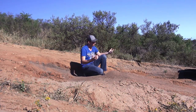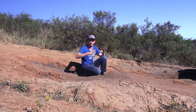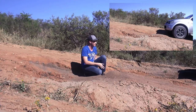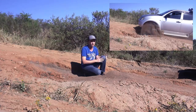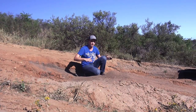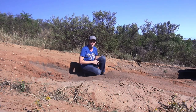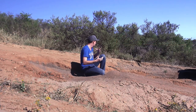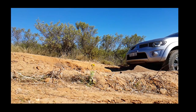You can see how it pretty much works right there. One of the wheels wasn't getting enough traction and was just throwing all the power to that wheel, so you're not going to go anywhere. That rocking it was doing — that's just going to snap CVs and all that kind of thing if you start hammering it. Spinning wheels won't get you up; you might as well get a new line. But in this situation, turning the traction control on — it struggled the first time but tried again and got up no dramas. The slow-mo footage shows just how that works and how it pushes me up that hill.